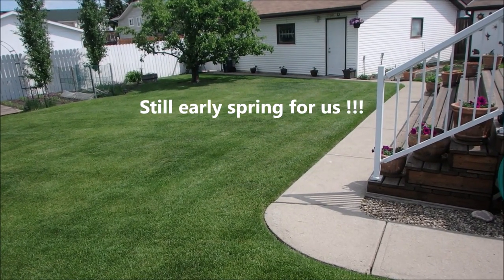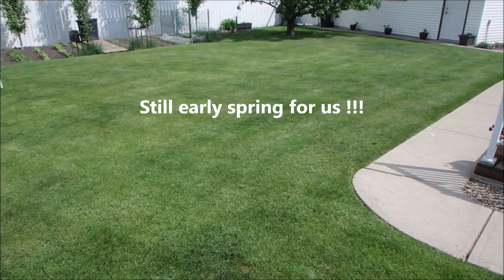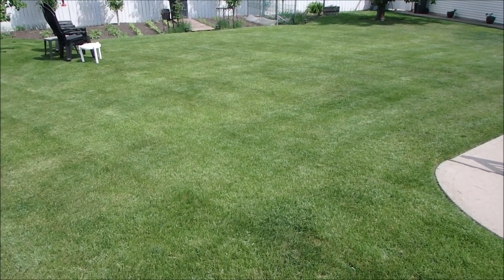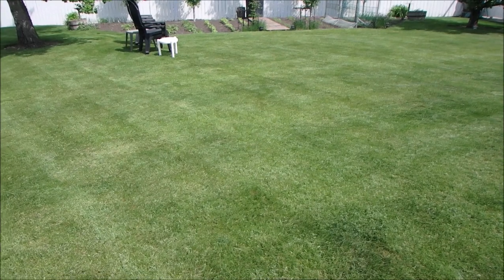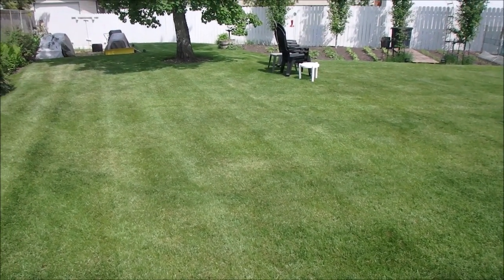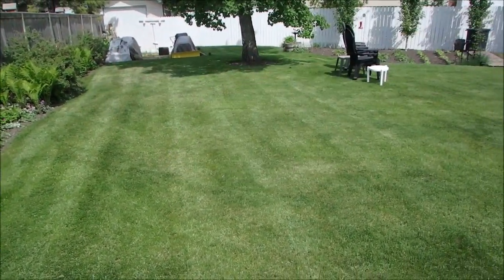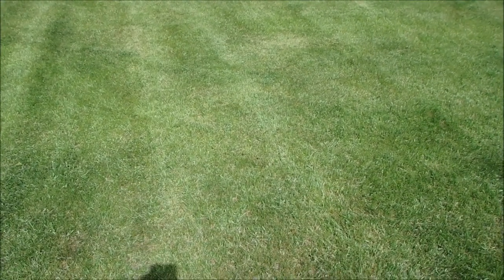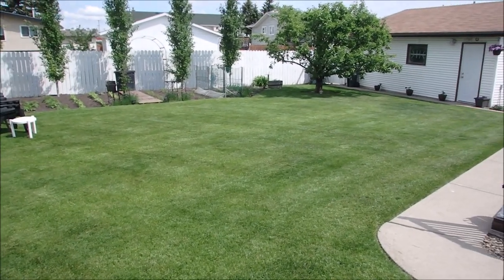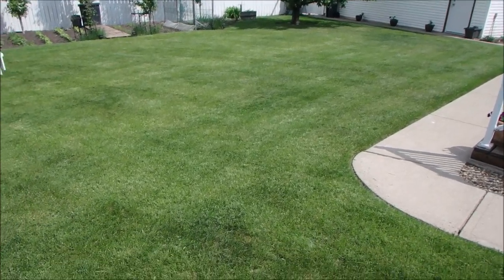All right, guys. I just cut my lawn. There's no more rooster tails, with the sharpened blades, and then I kind of rearranged them so that I put the one narrow upper blade in the middle. And I didn't have to overlap. As you can see, there's one track, two tracks, three tracks there, and there's no overlap. So this will go with the LX178 blades video.